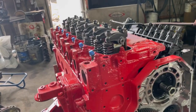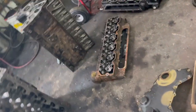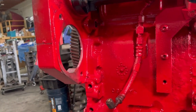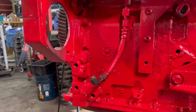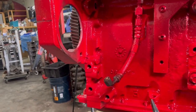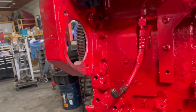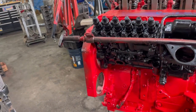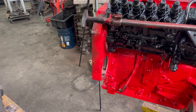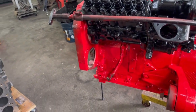For the 12-valve, you need to find your top dead center. The easiest way to do it — there's usually a pump in the way so it's not quite accessible, but this right here is your timing pin. If you roll the engine around you'll feel it snap in. If it's really sticky, I pop the metal retainer out, pull the plug right out, and use a bore scope or a mirror to see when it's lined up. That by far is the easiest way to do it.